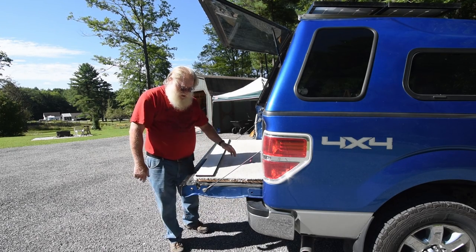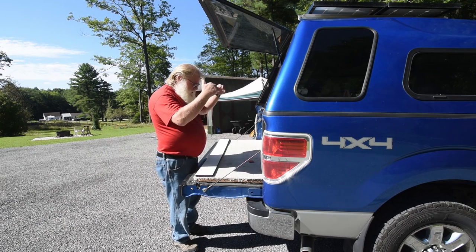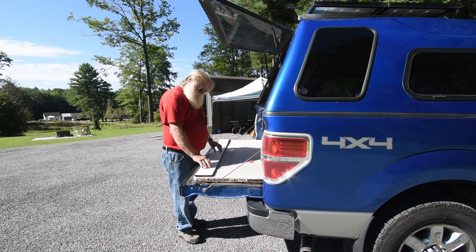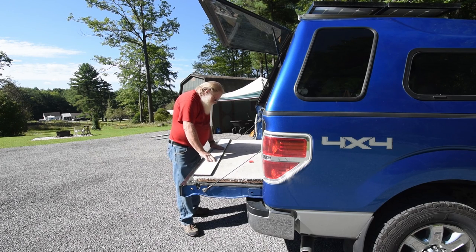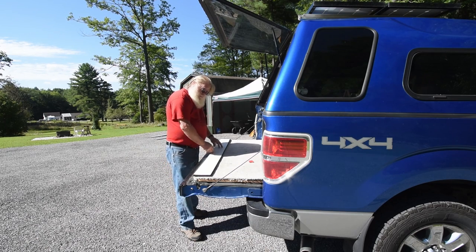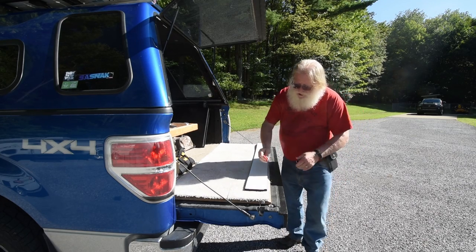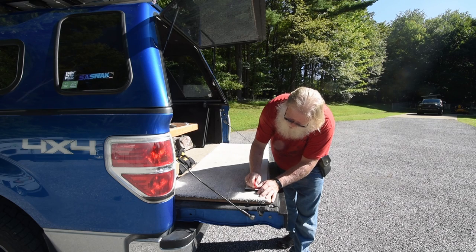What is happening here is I am showing you that the new seal, which is properly cut to length, has a backing on it, and it needs to be placed on the Aliner roof in the right place. If you pull the entire backing off and try to place it down, it makes it hard to put in exactly the right place. So what I have decided to do is to take my razor blade and make a slice just barely through the white adhesive backing that is on the seal, and remove it after it is in place.